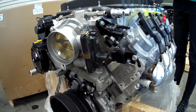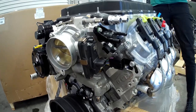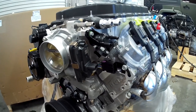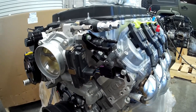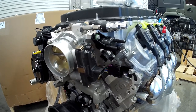The technology is still in the engine. One technology is active fuel management. This engine does have all the active fuel management equipment in it, but the GM controller package does not utilize it because they don't know the weight of the vehicle, and there are other concerns. One of the things we do is use a factory harness and factory calibration, so we're going to be using all this technology.